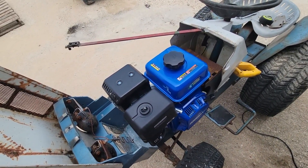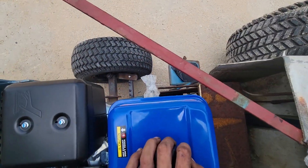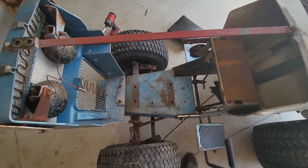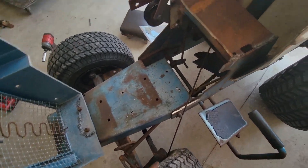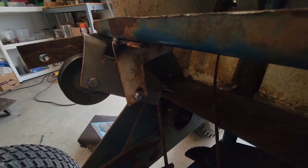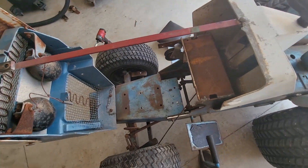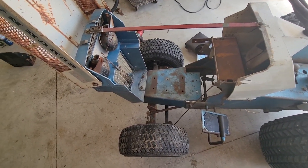I might have to take the shroud off for the air filter or modify it or something, because I'm not going to cut a hood — I've never cut a hood on anything and I'm not about to do that. So I'm going to get some stuff done and come back. Made some progress on the '66: got the four holes drilled for the engine, the frame cut out, got the new battery tray welded on, and the clutch actually fastened on. It actually stops right there, which is kind of cool. Had to notch out the frame right back there just because the clutch is way farther back than where it would normally be.